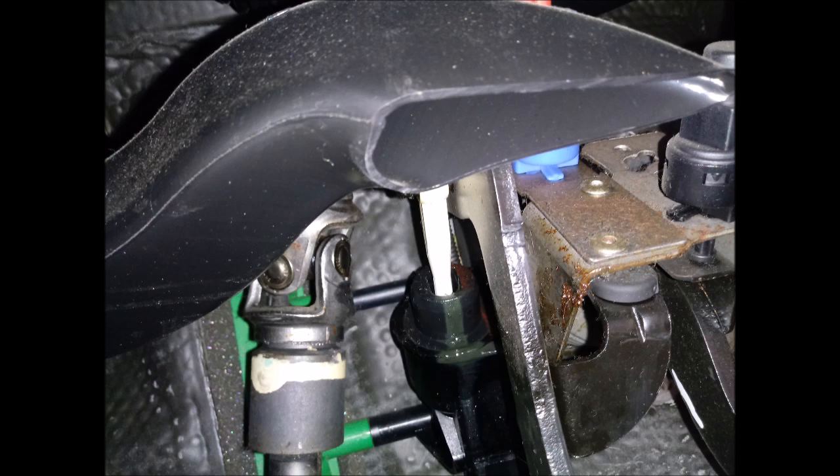Even then I couldn't get them in - I had a lot of leverage on them and in the end used a little screwdriver in the bottom screw hole and pushed back on it. The two little bottom silver bolts are actually self-tappers and they'll tap in, but it's really awkward and hard to get the top one back in - that's why the ratchet style spanner is useful. You can put the bolt in the ratchet spanner and actually lift it up into position. Even then there's barely enough length. Real nightmare, really poor design. Get that in and tighten those two bolts up - once you can tighten them, you know you're in position.